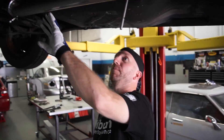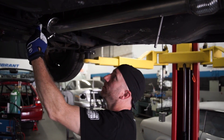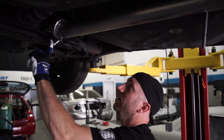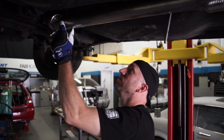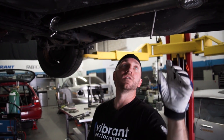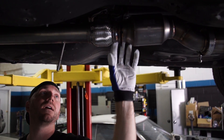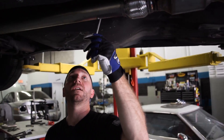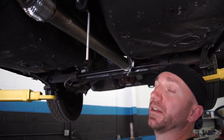I've got all this piping mocked up to go over my axle back here. I've lined up where I want this pipe to be. I've got a little support here that's just holding the pipe off of our sway bar that's running underneath. I've checked all the clearances and I'm happy with that - so that orients this bend pointing in the direction that I want it to be. Now I'm going to tack weld my flex here, it's supported currently by zip ties. Once that's tack welded in place, I can continue with this hanger.